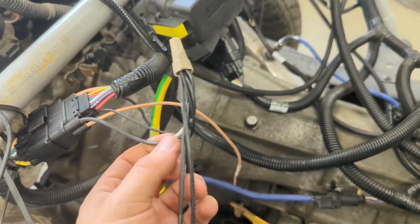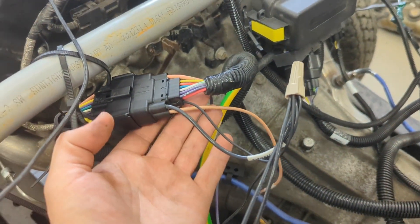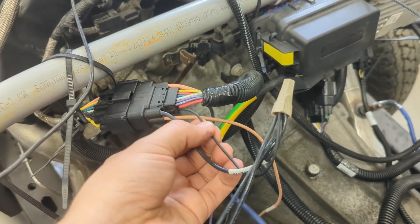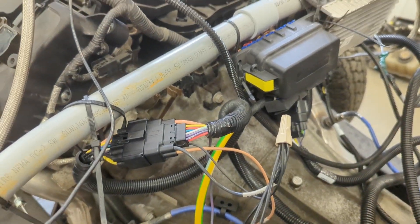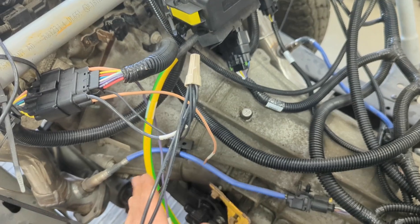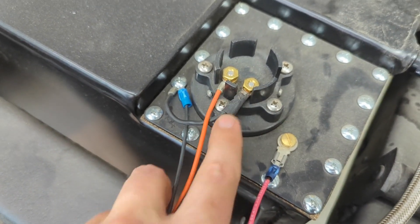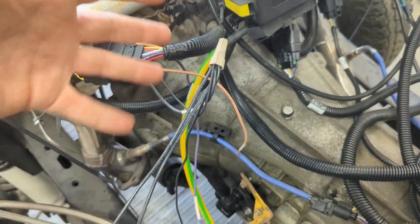The second item coming out of here is on the control pack — it says battery ground, so of course you'll tie that in there as well. Ours was one of the early 6R80 control packs and it was missing a pin or had some sort of repair, so your pack may or may not have this. There was also a ground from here, and if you don't have this ground, basically the fuel pump doesn't work. When you key on your ignition to run, the pump is supposed to run the whole time. Coming out of this wire nut is a ground wire that runs all the way back to the fuel pump — I just looped a little terminal under there to make a supplemental ground for the fuel pump and make sure it had a nice clean ground.